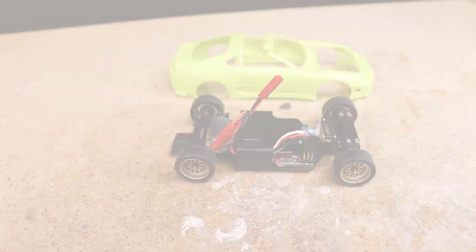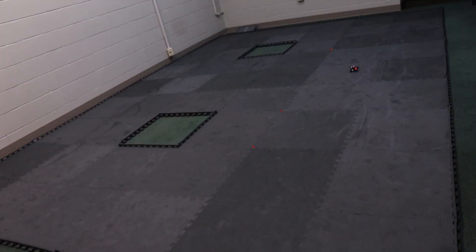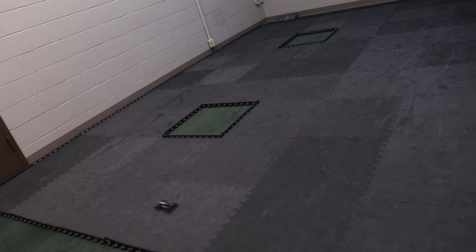With the chassis at this stage I wanted to do a quick test drive. It's a ton of fun to drive — the RF-130 is quick, almost too quick to really enjoy on such a small track, but still very fun. Since there isn't any gear reduction with this setup the acceleration isn't the best, but I kind of like it. It makes the driving more interesting and more video game-like, since the car takes a little time to get up to full speed rather than instantly hitting maximum speed.